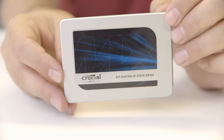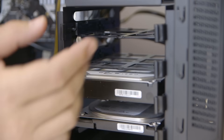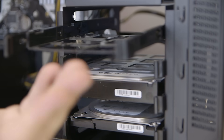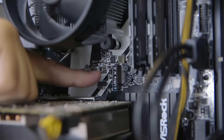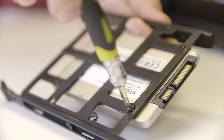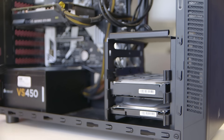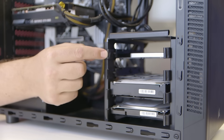So how do we mount one of those? You need to locate the mounting points inside your chassis where the standard hard drives are - you'll have brackets that you can put the 2.5 inch SSDs in, and the M.2 drives go into this little socket up here. You need to attach the SSD to the mounting points in your chassis. Here it drops into a spare drive bay, so you can just screw it into the caddy and drop it into the drive bay.